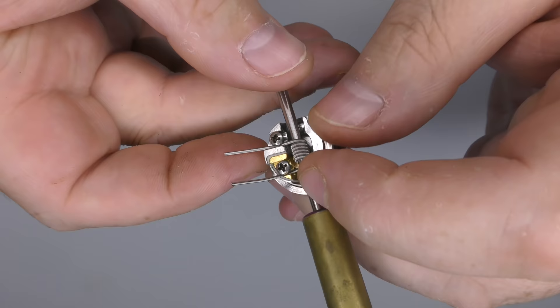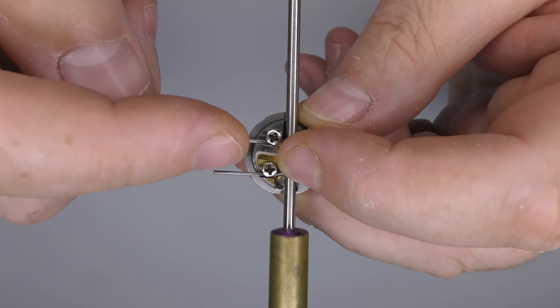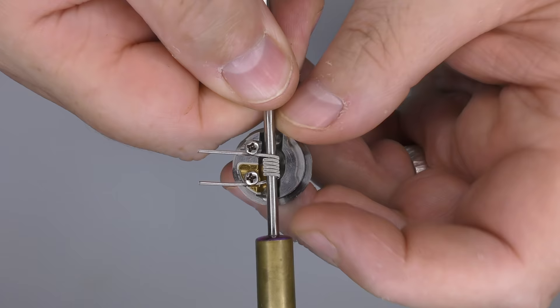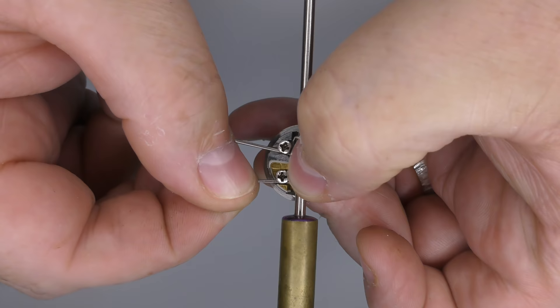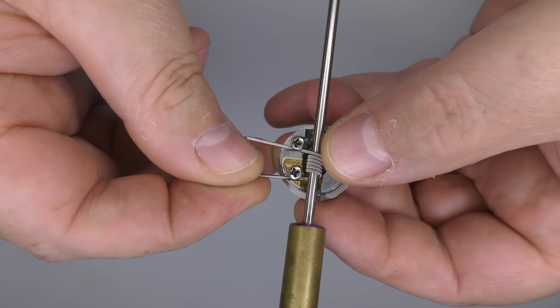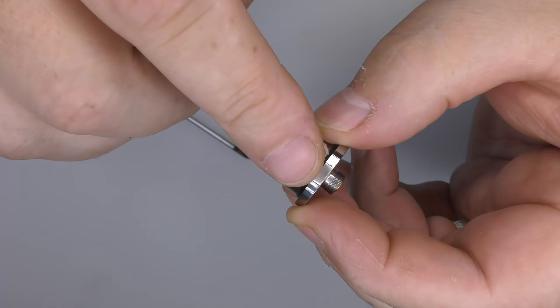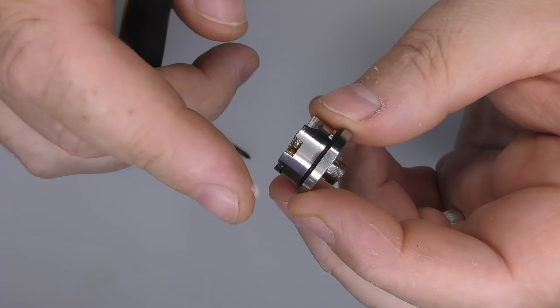I just realised I put the legs on the wrong side. When you tighten your screw clockwise, it's better to have your leg oriented so that tightening pulls the coil into place rather than pushing excess back out. That way when I'm holding my coiling rod and tightening the screw, it's tightening the coil for you. Make sure when you snip your legs, you're getting them in close to the screws. Run your finger around there — you don't want any sharp edges or excess wire sticking out that may touch the tank body.